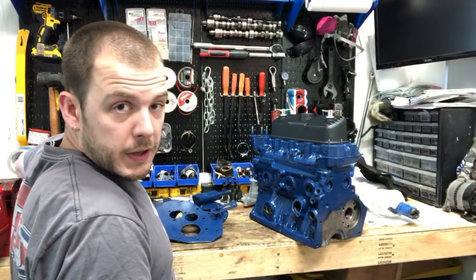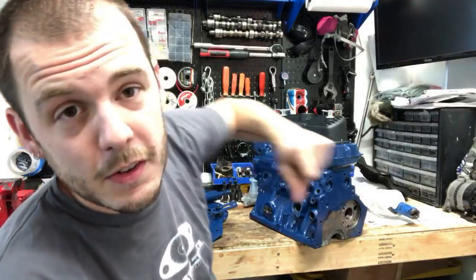If you have an air-fuel meter, that's going to help you a lot, and you want to be looking for a 12.7 ratio, but that's only if you have that meter. That's the sweet spot for road driving.